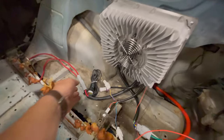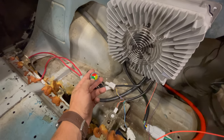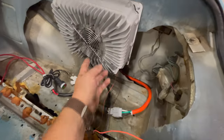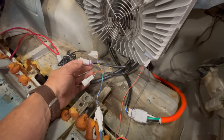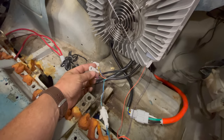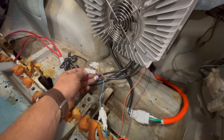Here's the wiring done for the charger now. This connector runs to the batteries. This right here is a battery status indicator — it shows whether your battery is charged less than 80%, between 80% and 100%, or fully charged. Then this one here runs behind the charger to the charging port. This is a 12-volt charger port, so if you have a 12-volt battery you can plug this onto it to charge that battery. And this is a driveway connector — you hook this up to an alarm or interrupt that will prevent you from driving away while you're still plugged into the charger.